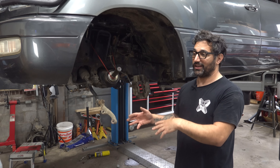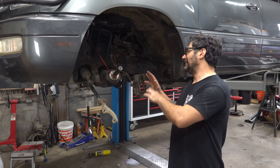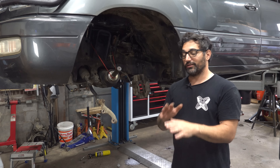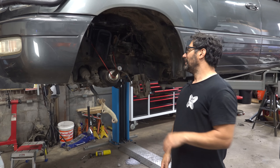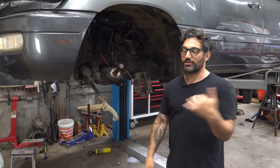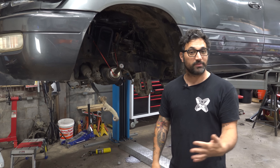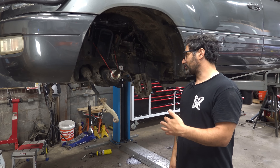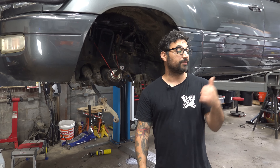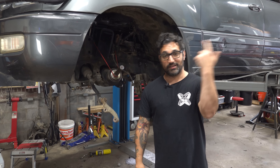Some of the stuff has to stay with the body on the frame — you can't get every pump out. But 90% is gone, which is great because we're going to go simple: regular shock springs and torsion bars. Upper arms, lower arms — all gone, all getting replaced. Everything had a quarter million miles on it, all the ball joints were shot. But this thing's going to be like a brand new truck now. I picked up a bunch of great parts and it's going to make this thing even better.